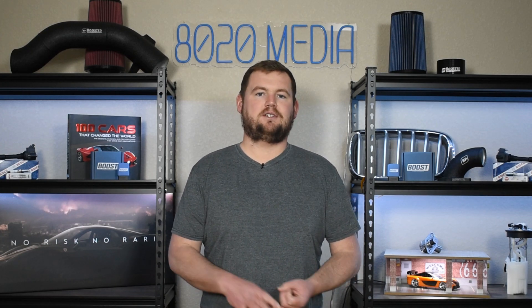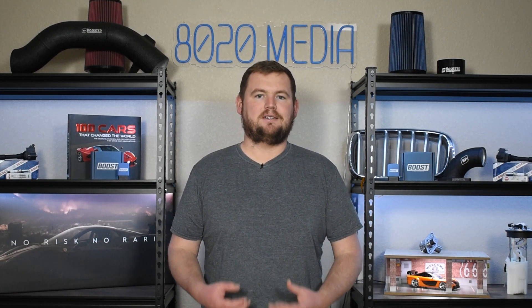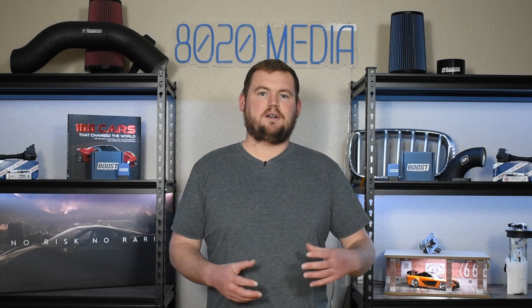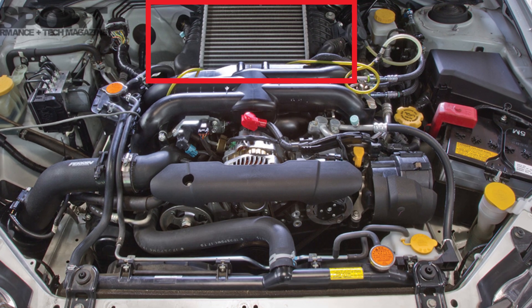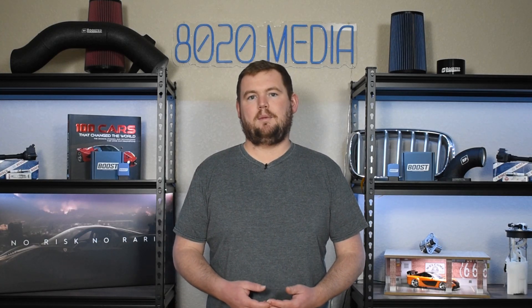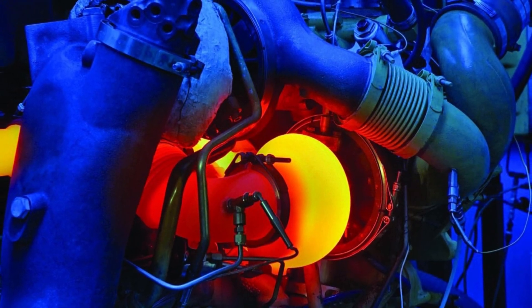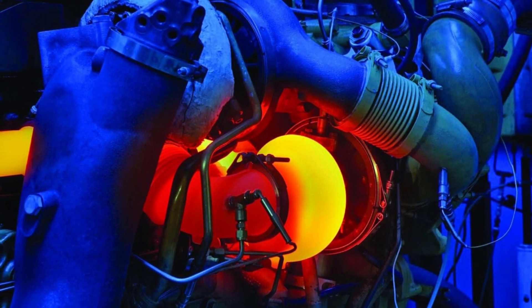Moving on to our next upgrade, we have intercooler upgrades. An intercooler upgrade on the EJ255 really isn't going to show any peak power gains on a one-off glory run. The point of an intercooler is for engine health and safety by keeping intake air temperatures in check, which also results in much more consistent, smooth performance. The stock intercooler is relatively efficient at stock power levels; however, once you do the tuning and downpipe, you're making more power and more boost, which leads to more heat. That's where the stock top-mount intercooler becomes very inefficient and the engine can start to experience heat soak, resulting in power loss and a greater chance of engine knock and detonation.